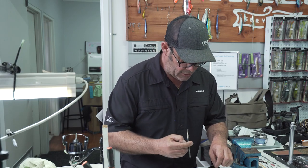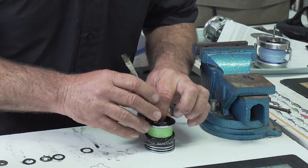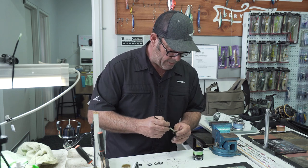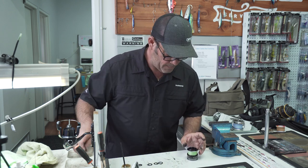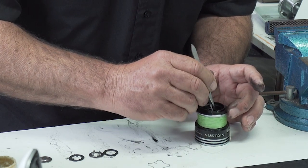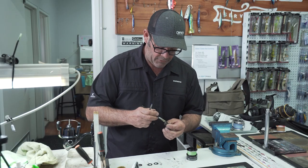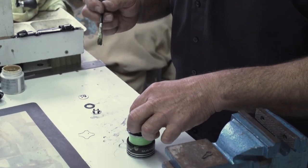It can be a bit nitty, a bit tacky. Same as before, put grease on both sides. I'll lube up my plates. There's a little keyway on those — you've got keyway slots inside the spool, so it's common sense, you just follow it as it goes. Don't be afraid to get your fingers dirty because you're working that grease into the pores on those washers.